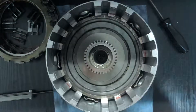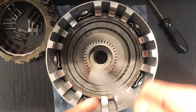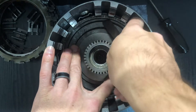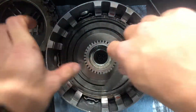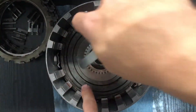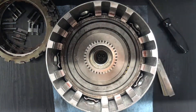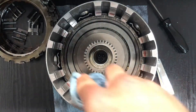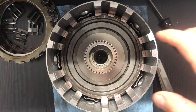Since we just put everything in, I'll spin and shake it to get everything perfectly settled. Push it a little bit and I'm getting 31 thousandths right now. 31 is fitting, so everything's good. That's what I do to check my clearance — get it all flattened out and check it. Forward clearance I don't think is too much of an issue as long as it's not too big, since it's not shifting unless you're going from reverse to drive, which you should do very seldom.